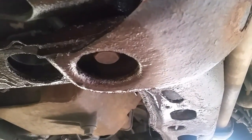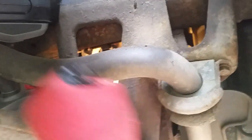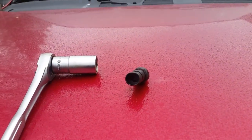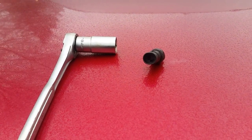You can see it's getting pretty bad. I've neglected it so long I felt guilty, so today I'm going to go ahead and change it out. I've already got a sensor for it. There's not a lot of room in here, so you've got to figure out a way to get your hand up in between the sway bar, or perhaps through this hole here. We need a deep well socket to get that off — it's a 27 millimeter six-point. And there's my sensor that I'm going to be putting in. It's a used one I've had forever, in good shape, doesn't leak.